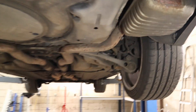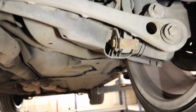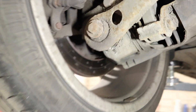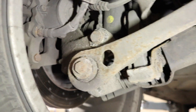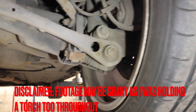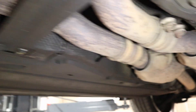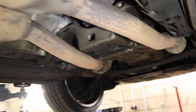Moving to the underside of the car, we'll start at the back. It does look pretty standard — just what you'd expect to see with a car of this sort of mileage and age. Nothing — no fluid leaks, no oil leaks. Shocks have been replaced on the rear so they should be okay, and they are. Exhaust looks pretty good, no leaks from the diff, exhaust system looks good as well. Nothing major — give it the old tap, nothing loose, all good, flexes are good.